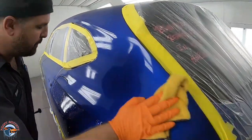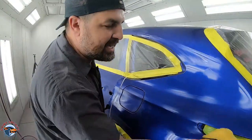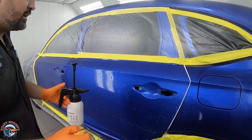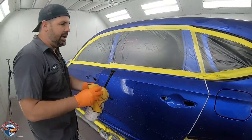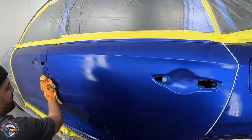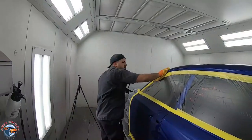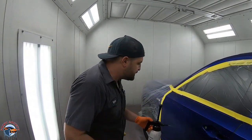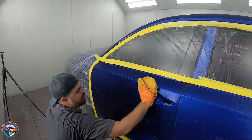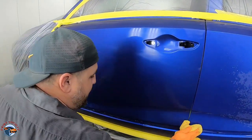If you go across the panel, it's not going to be a big deal, but we want to wipe them off. The reason I like the water-based cleaner is because it gets deeper into those sand scratches. Go panel by panel and be very liberal with it — soak the whole panel as if you were washing it down, then wipe. These microfiber towels are great because they don't get soggy. I like to use water-based cleaner first, but it can leave it a little streaky. The wax and grease remover will leave it less streaky. You can also use Sprayway Glass Cleaner from the store.